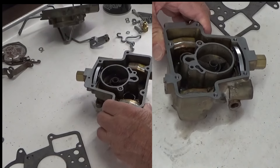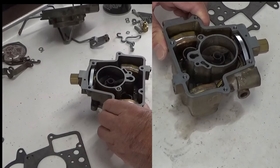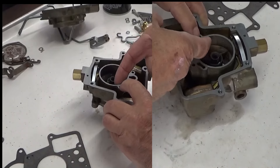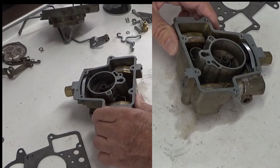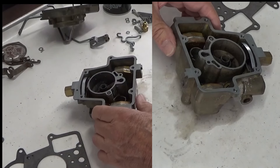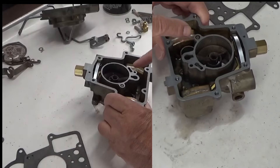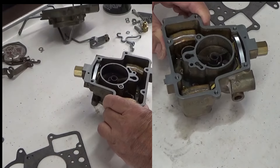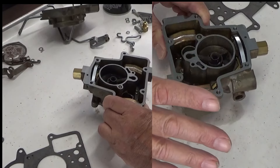In the morning when you're cold, you close the choke and pump the gas once. What that does is allow one squirt of gas in there, and that helps on a cold start. If you're having trouble starting in the morning, make sure that's happening. It could be that the gas is going away at night for various reasons, so that's something you can check out.